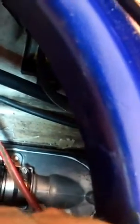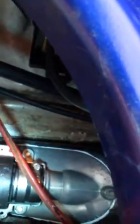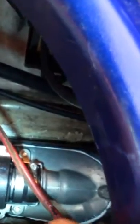if you don't go in straight, that shaft is going to go alongside the impeller on the outside of the impeller. And when you get this thing all back together and you fire it up, you're going to hear a god-awful noise, and you're going to wonder what you did wrong. And most likely what it is, the shaft is on the outside of the impeller. It did not slide into the impeller.